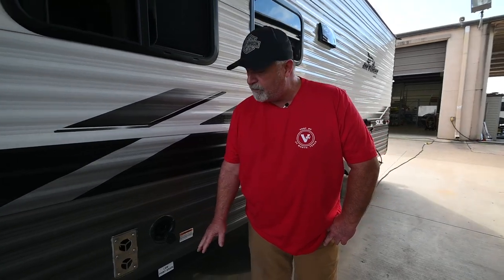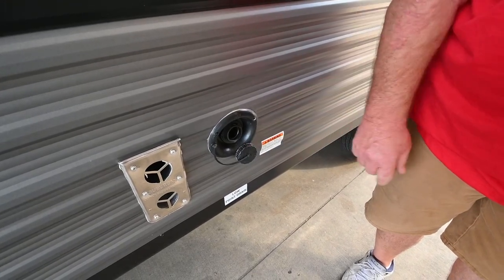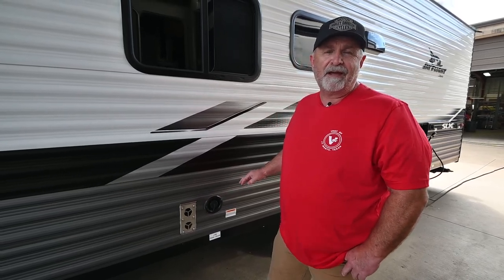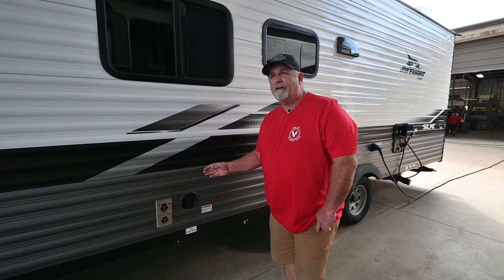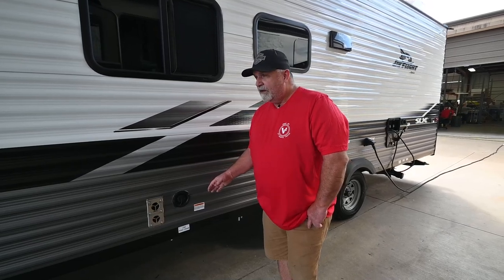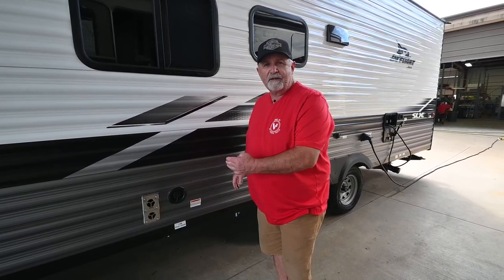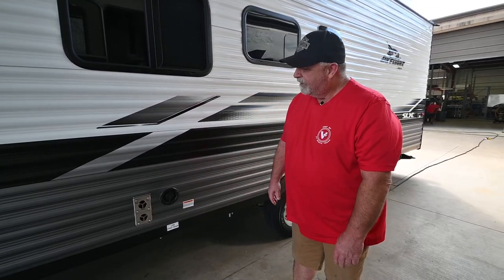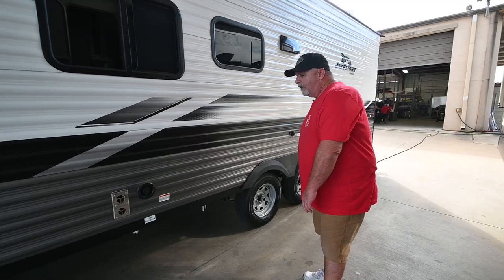If you're going to camp off the grid without access to water, this is your freshwater holding tank — connect a garden hose and fill it until it overflows. Typically you want to wait until you get close to your campground before you fill it, because that's roughly 400 pounds of extra weight you don't need to drag down the highway. I'd recommend filling it about a quarter of the way full. That way if you're an hour between restrooms you can pull over, turn on the water pump, and use the restroom easily. A quarter tank won't weigh that much.